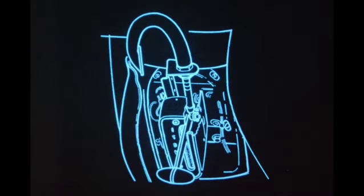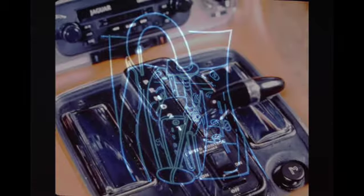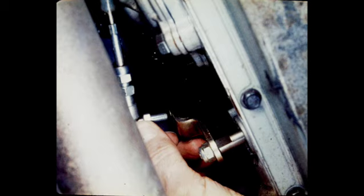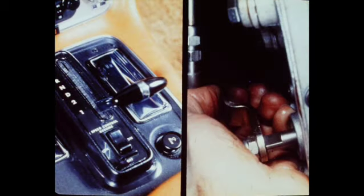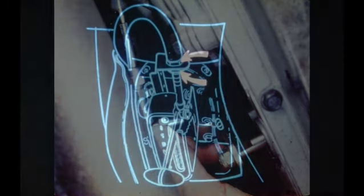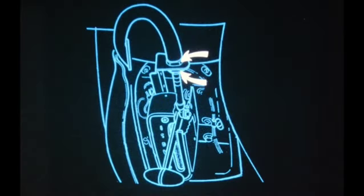Number four: proper adjustment of the gear selector cable must be made before returning the vehicle to service. Incorrect selector cable adjustment could result in early failure of clutches and bands. Adjust the cable as follows: place the gear selector lever in position one. If necessary, disconnect the selector cable at the transmission. Then ensure that both the selector lever and the transmission lever are in position one. The transmission lever is in position one when it is fully rearward. The selector cable adjustment is correct when it can be connected to the transmission lever without moving either the selector lever or the transmission lever. After removing the center console trim, adjust the cable with the front and rear lock nuts until the connection can be made as described.